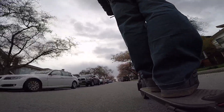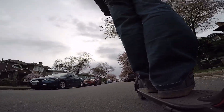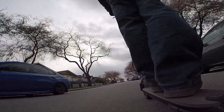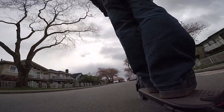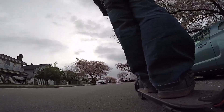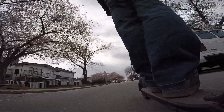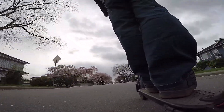Now, solid tires. The idea of never having a flat tire is great, but at the cost of tire grip, speed, and range, I don't think it's worth it. I've reviewed the solid tires and I don't like them at all. I've also had a bunch of comments about poor traction, top speed, and range. So if you have poor performance and are using solid tires on the front wheel, they might be the cause.